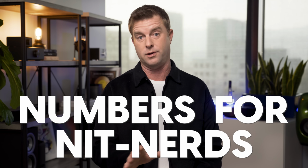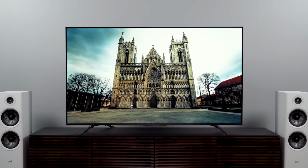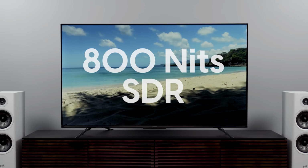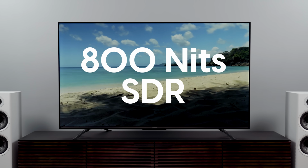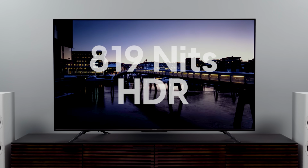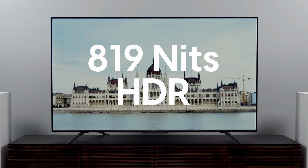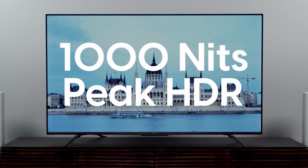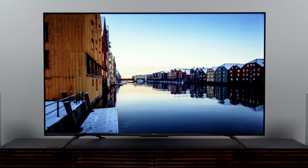With that said, normally I leave this for later in the video, but today I'm getting straight to numbers for nit-nerds, and I suggest staying tuned for this part because it's central to this idea that the U7H might be the better choice for a lot of folks. Okay, so I gathered all my gear and I measured the Hisense U7H's peak brightness in SDR at just over 800 nits. This was in filmmaker mode with the backlight maxed out, so quite bright. In HDR, I measured sustained peak brightness at around the same 800 nit level, 819 nits to be exact, with peaks coming in just under 1000 nits. So clearly, this puts the U7H well under the U8H in terms of peak brightness performance.